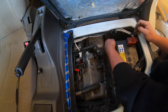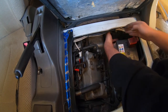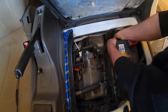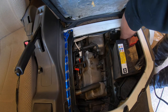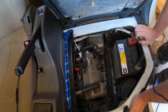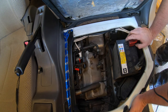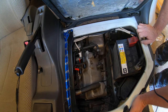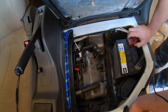Maybe the ECU memory is remembering the fault and hasn't reset itself yet. You might need to leave the battery disconnected longer, because these ECUs do have a memory — unlike the Cappuccino which does not. There might not have been anything wrong with the original coils at all — that's the sad part. I won't know whether any of this has done anything for quite a few drives because it's intermittent. Anyway, we've done what we set out to do: change the coils. That has been accomplished.